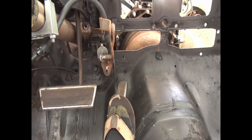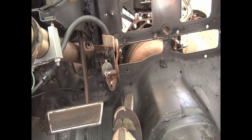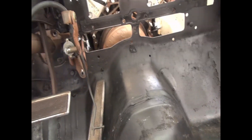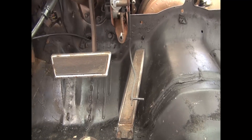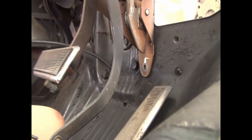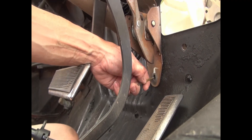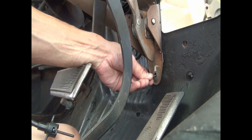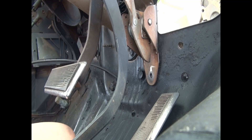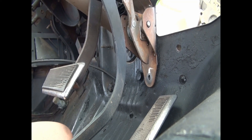I think I got lucky in that position. I could put it at an angle but it's not hitting the tunnel. I'll try putting the new pedal underneath the original pedal and see what kind of angle it gives me — maybe I can keep the old pedal there. Looks like I can't put the old pedal on top of the new pedal. I'm gonna center punch the hole for the bottom bolt. It's kind of difficult to center punch it with one hand but it looks like it's gonna go right there. Now I'm gonna put the camera aside, drill that second hole, and mount it.